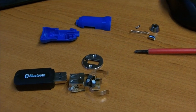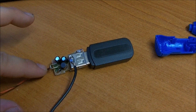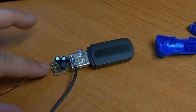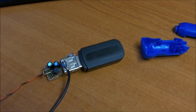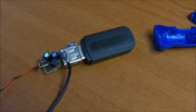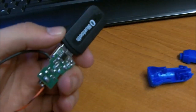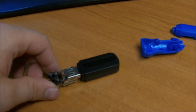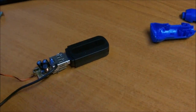And that's the power sorted. I've soldered on my positive and negative leads — the positive was soldered onto where the spring goes from the end terminal and the negative just goes onto the ground of the USB. I've plugged my Bluetooth module in and I'm just going to wrap this up in tape, making sure the USB bit doesn't pop out and the wires don't ground out on the car anywhere accidentally.